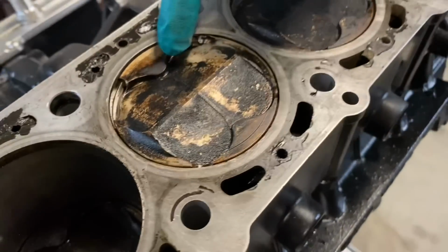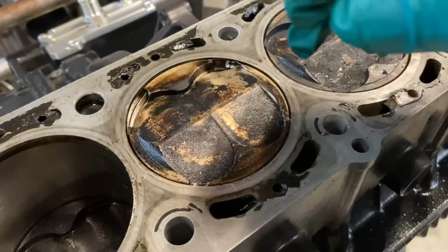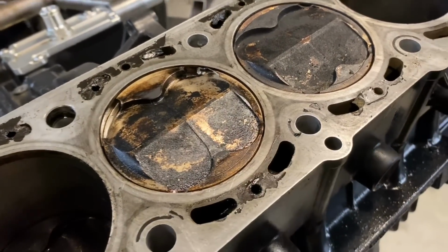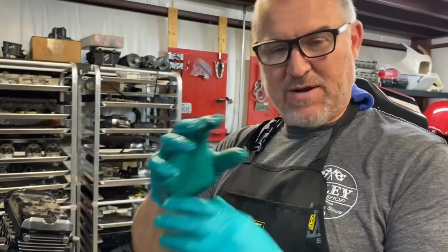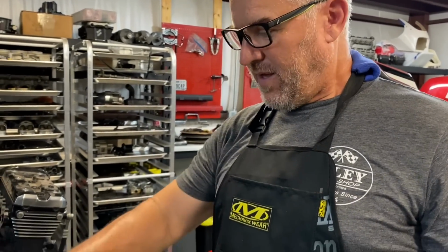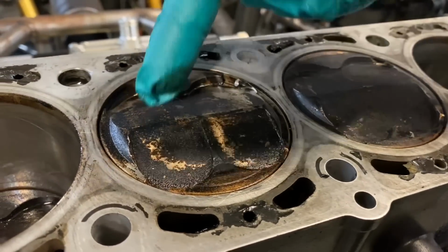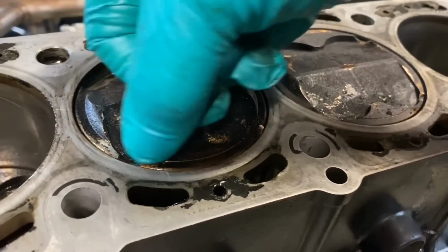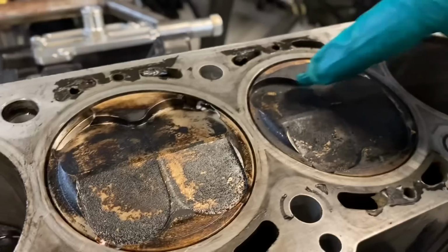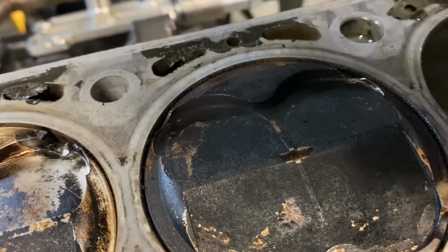This pocket is cut back over the top of that ring, and so if you could look at a 3D drawing where the materials were there but they're transparent, like on a 3D program, you'd be able to see that there's just a very tiny bit of material in those, because the intake pockets are much larger than the exhaust pockets. These hold up okay. I think there's enough material in there, but if you look right here, there's like nothing. It goes all the way out to the edge of the cylinder, and then the piston dips down.